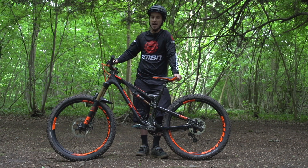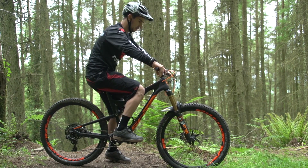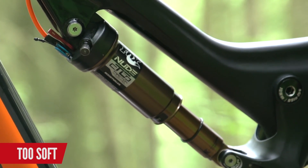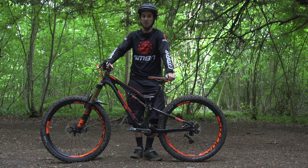Let's first start with the basics of suspension setup and sag — that is how much your bike sits into its travel with you on it. If it's too hard, it's almost like having no suspension at all. If it's too soft, you'll end up sitting way too far into that travel. If you haven't seen it already, check out our video on how to set up your sag and get that done first.